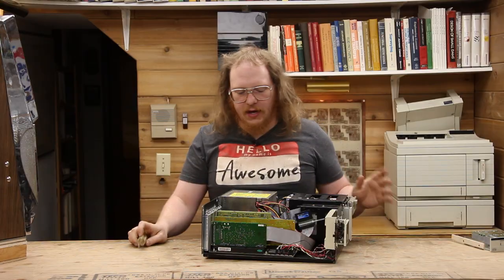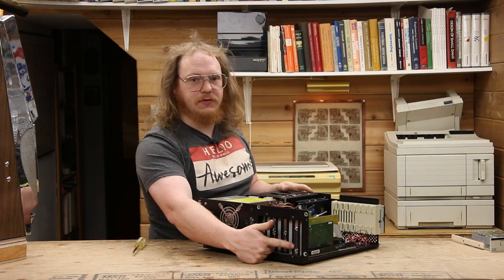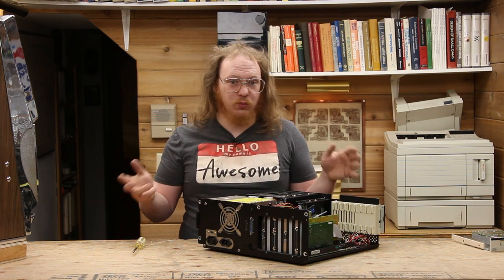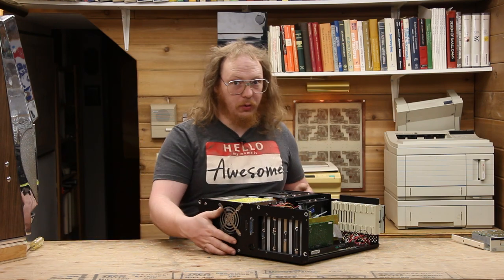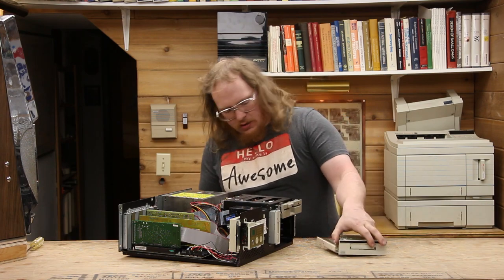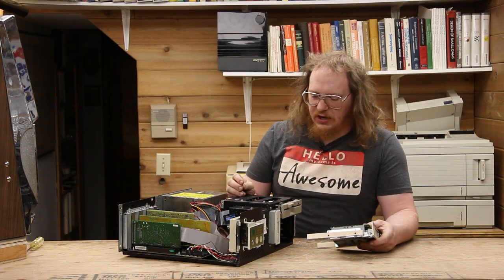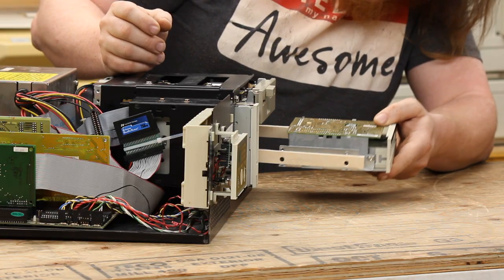At any point, you may be able to add an additional tape drive through the back port on here — I don't have the documentation. But for the most part, if you're just doing one drive and one card, you really don't need any additional documentation. It's almost plug and play. For the tape drive on the front, I've already made these little fancy drive rails — they're made out of wood, because at this point many of these computer cases have lost their original drive rails. But I can just slide that in once I take out the set screw.